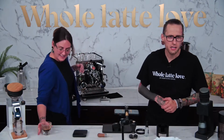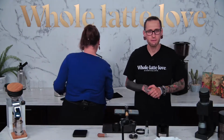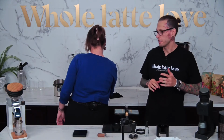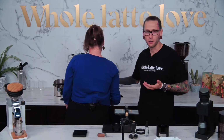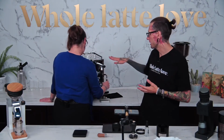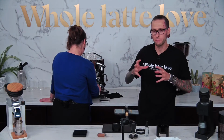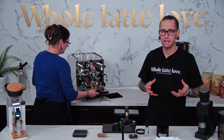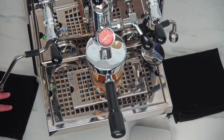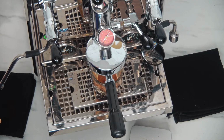So Andika is asking, when do we have to change your group head pressure? I would honestly say, don't worry about it yet. You will be able to get into manipulating your flow and your pressure a little bit, but most machines are going to come set to a standard of somewhere around 9 to 10 bar of pressure. And that's really the ideal pressure to be using with espresso.